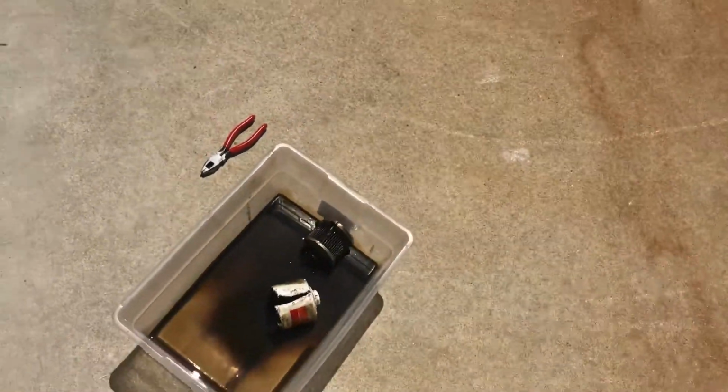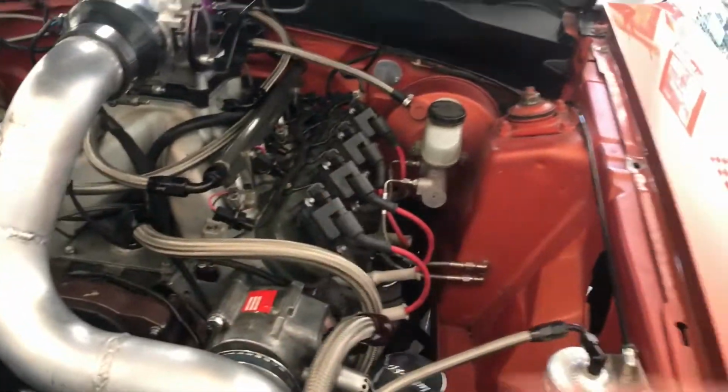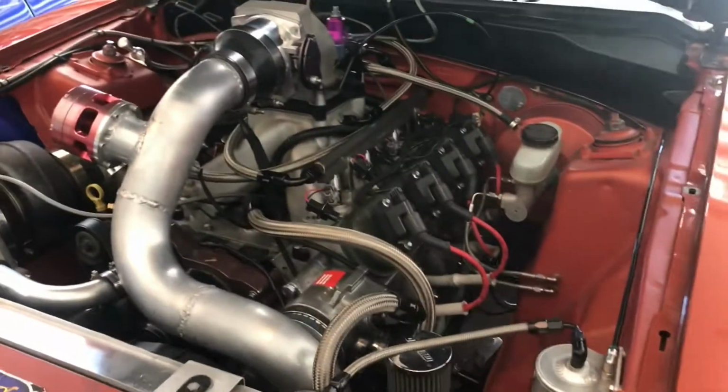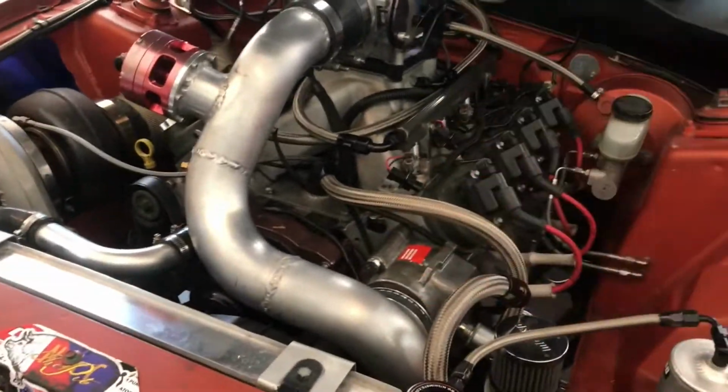You can't use your regular oil change intervals on the first fire up of a fresh motor, a used motor. You can't sit here and think like, well, it's a motor that already has 140,000 miles on it. It's broken in, just let it ride. Dude, change it. If you've been inside of it and you messed with it, change it.